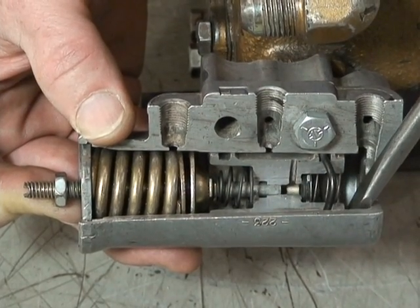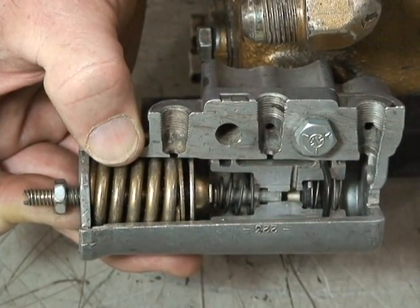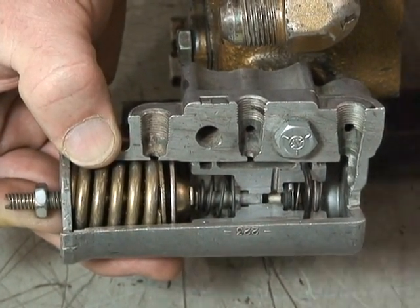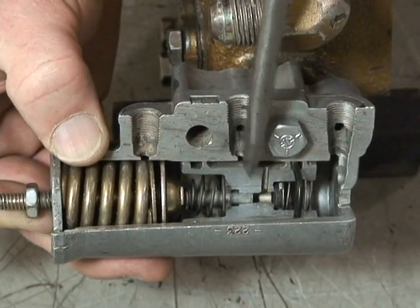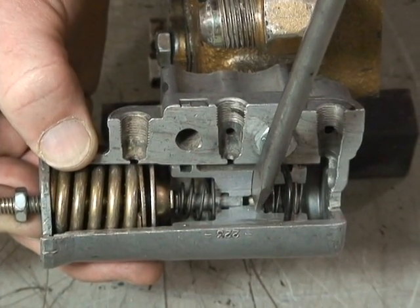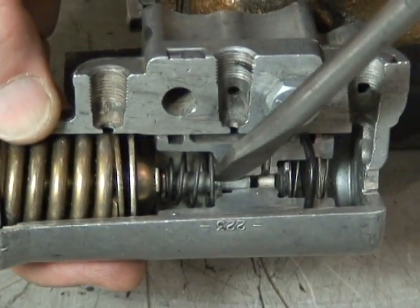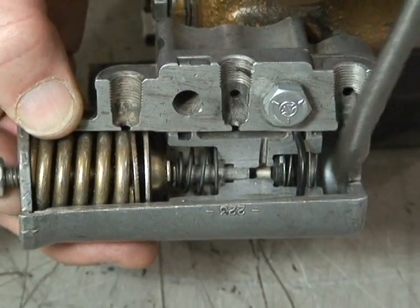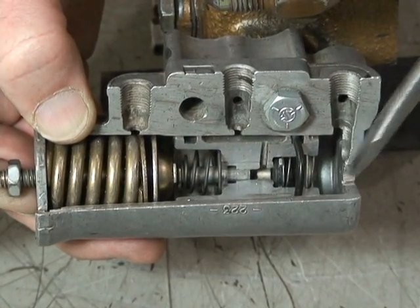Until we get enough air pressure to compress the piston, the air dryer and the unloader valves will be exhausted to atmosphere through this port. Air will come through here, through this little cutaway or hole in the piston, through the center of the exhaust stem — it's a drilled passage — past the o-ring and onto the exhaust. So they're open to atmosphere right now. We've got wet tank pressure on the end here but it's not at cutout, so it can't compress the spring.